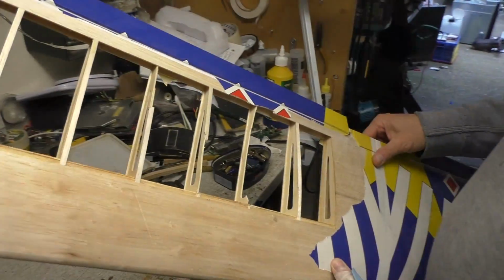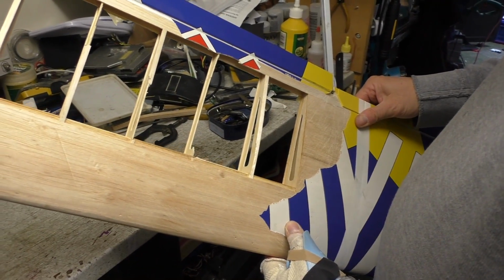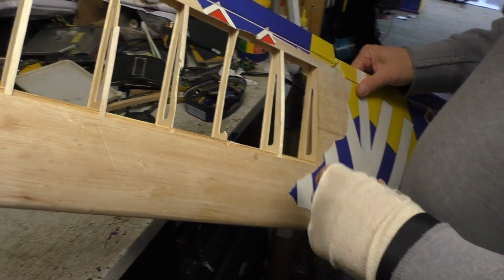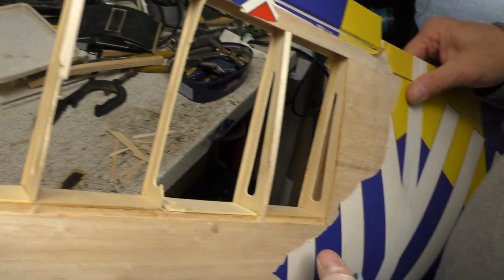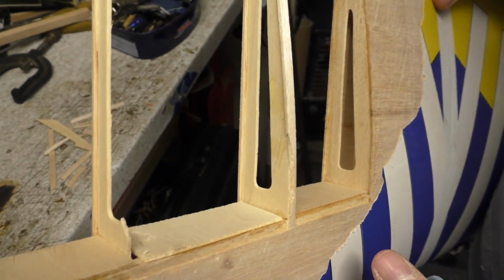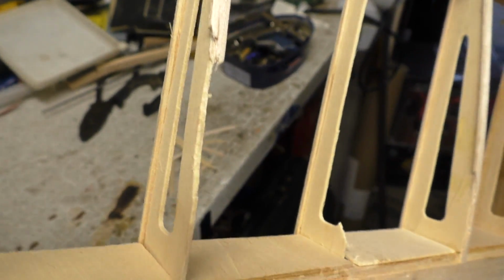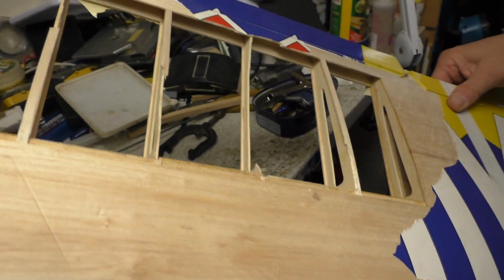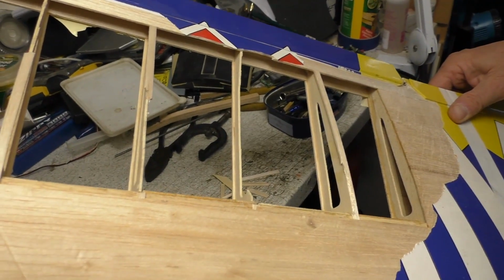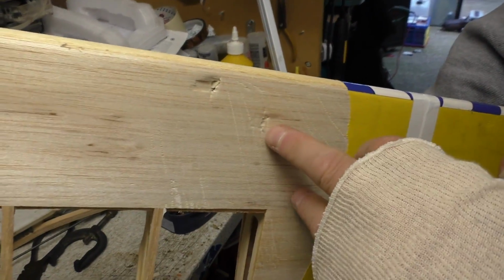Right, we've moved on to the wing. That's the worst of the lot while we're waiting for the bearings to come in. So there is the damage. As you can see, we've got most of the missing rib there and the cap strip, and a bit of a missing rib there, and another bit there, cap strip's missing. So basically we've got three and a bit ribs to fix. Oh, and a dent. And there's a dent on the underside as well that needs fixing. Another one there.